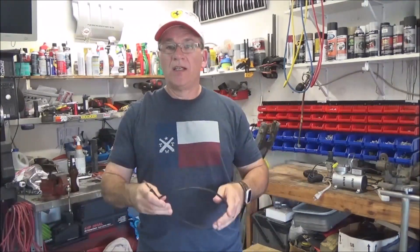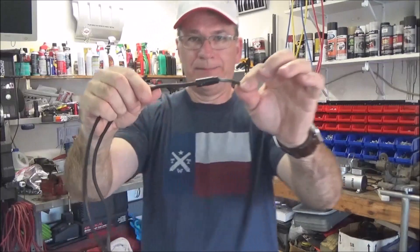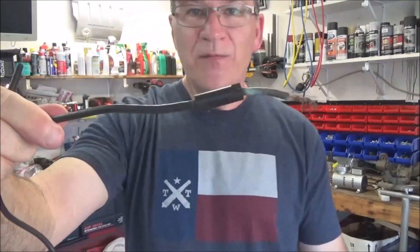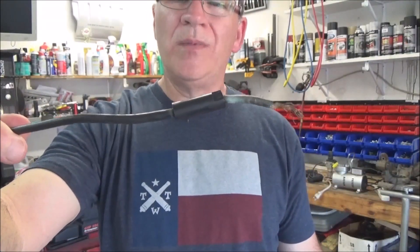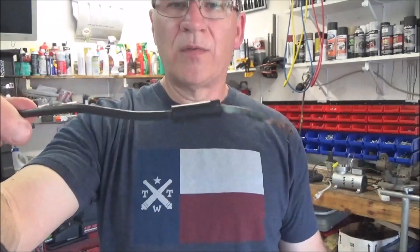The charging system was failing a little bit and I was having a hard time to start. I pulled the alternator out and tested it — it's fine. Got a brand new battery in it, obviously that's fine. Then I found this: the fusible link right here. That piece of crap — this little tiny wire. It was actually squeezed into the old battery terminal. It was starting to fail inside there; although it hadn't melted through, that's where the problem was. There was continuity, but it was kind of weak.